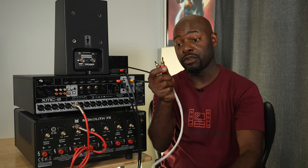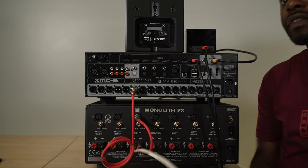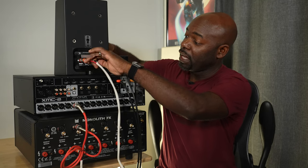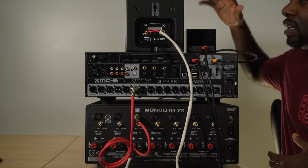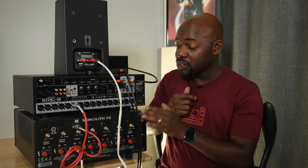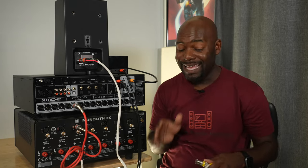Remember: red with red and black with black. I plug in the red and black speaker wires for my right speaker, then plug the other ends into the speaker — again red with red and black with black. The way this works is: audio signal comes from your TV or streaming media box, your processor decodes that signal and sends it to the amplifier, it gets amplified, and then that audio signal is sent to your speaker. If you have multiple speakers, you do front left, front right, and so on with speaker cable for each.